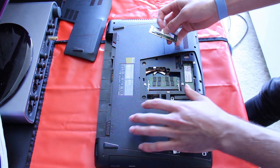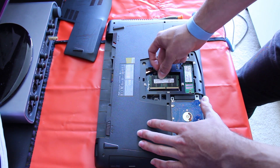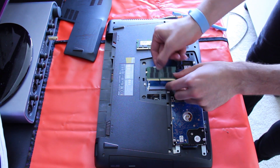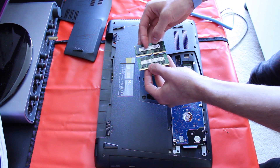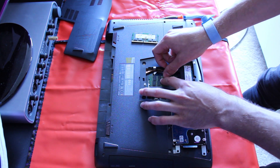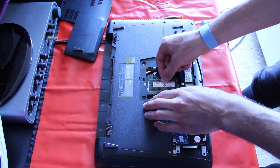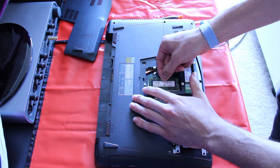It really does matter which way you put it in — you have to make sure it matches up with the notch. If you put it in upside down it's not going to fit. This is pretty much true of all RAM sticks. So I'm just going to take the old one out. The way you take them out is you pop those little clips aside and then pull it — it'll just kind of pop out. You can see the notch is facing more towards the right. I'm going to pop this one back in, the bottom one — you put it into its little notch and then push it down. I had a little bit of trouble with this second stick because it didn't really seem to want to go in. I had to try and coax it a little bit.